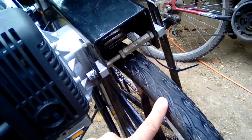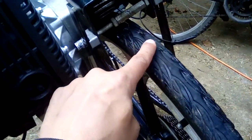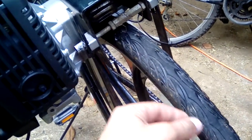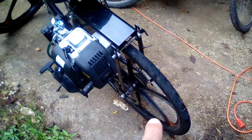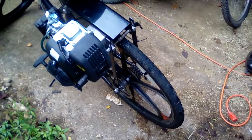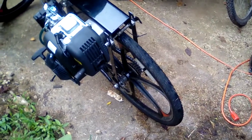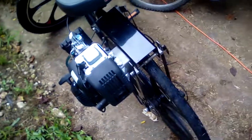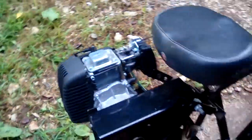And that really solved the problem. So with this kind of drive, you want something for the drive tire that really doesn't have any nubs on it. They do make a combination tire that's like a racing tire in the middle but has nubs on the outside like a mountain bike — that would be good. They just didn't have one when I went to buy this one. The other thing you want to look for when choosing the back tire for a friction drive is you want to make sure that the rubber is stiff rubber. The real floppy paper-thin rubber will just get absolutely destroyed by friction drive.